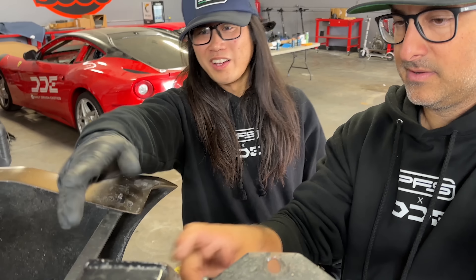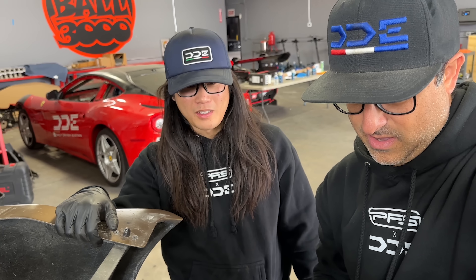We'll measure this side from here to here and then do the other side, because these are actually in different spots. So we'll have to measure both sides and then we can cut and grind them smooth. We'll also need to pull the front shocks off because the front of the car is high as well. There was apparently only one shock that fit in this car because of where they put the suspension pickup points — they're using MR2 suspension on this thing, and with the front slanted down to look like a supercar, the shock sits lower, which makes the car higher.